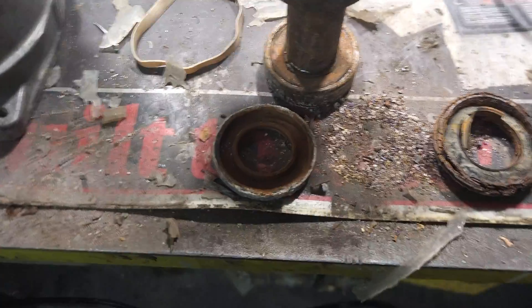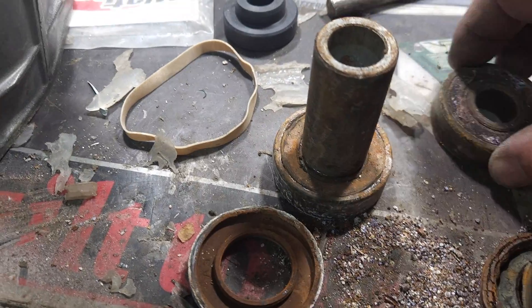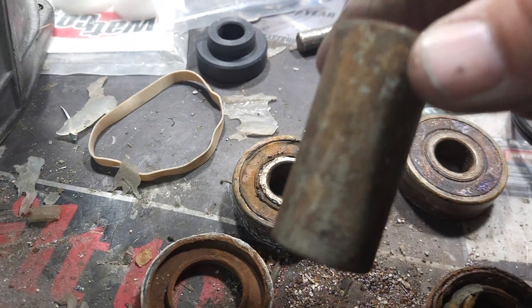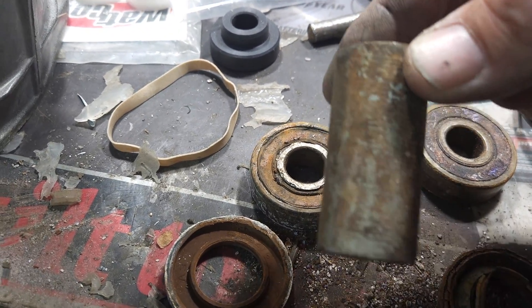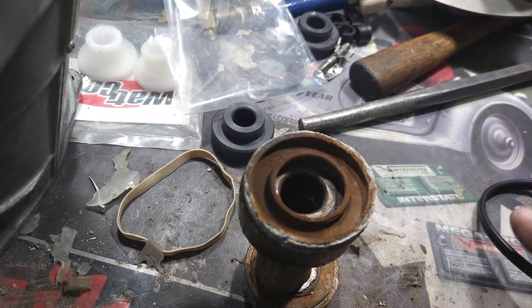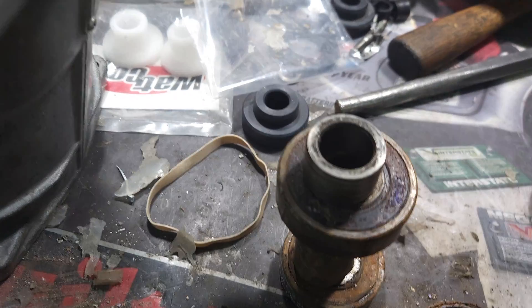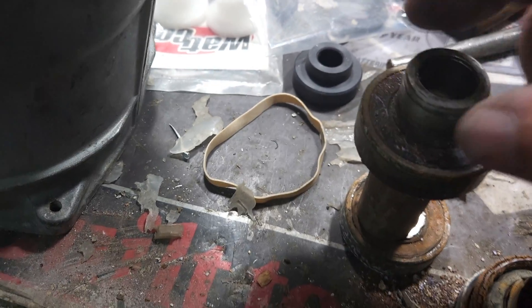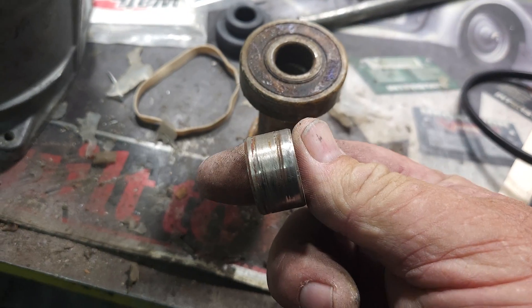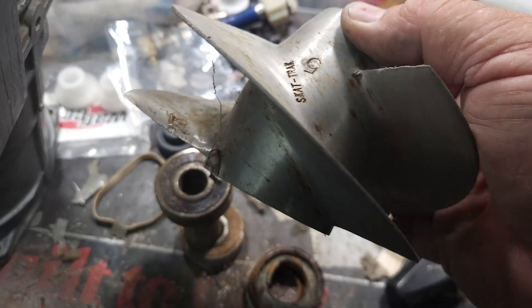There's our pump. There's our old bearings, our old bearing spacer — it's all junk, you can see it's all in bad shape. The bearings come in from the bottom there — the bearings are trapped both directions, they go in from the top and the bottom. This sets your depth — this is so you don't crush the bearings. You'll know when it's right when this thing is trapped in there, and you have to make sure it's centered so that the shaft goes through. You've got seals on top. And then this little guy here sets your depth for your impeller, and then your impeller sits on top of there. This is your sealing surface — this keeps the water out. This was in pretty bad shape, but I hit it with some emery cloth and it cleaned right up. We'll put this all back together, put the impeller in, grease everything, anti-seize. We've got a straight 15 — we'll throw that in the pitch gauge and make sure it's actually a straight 15.